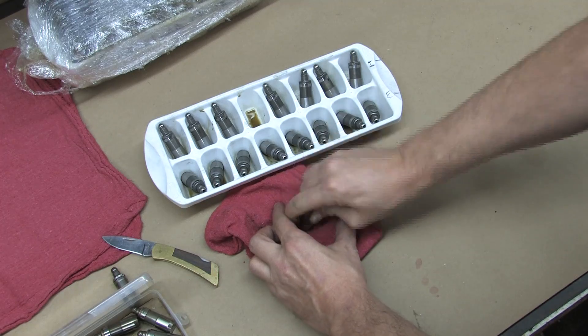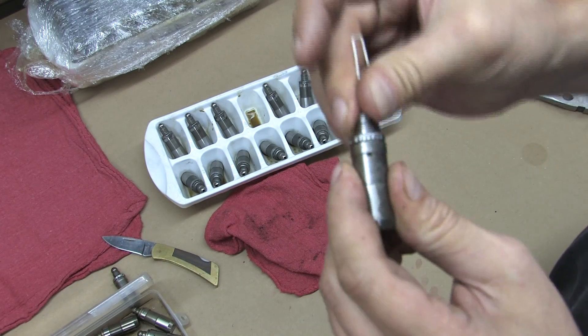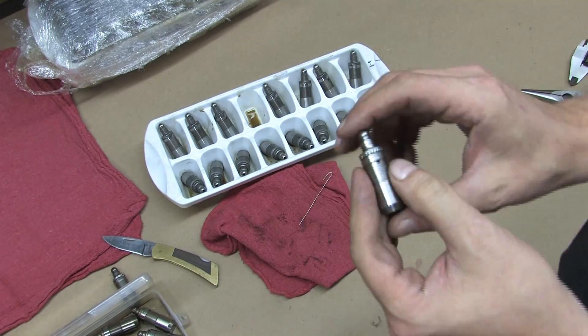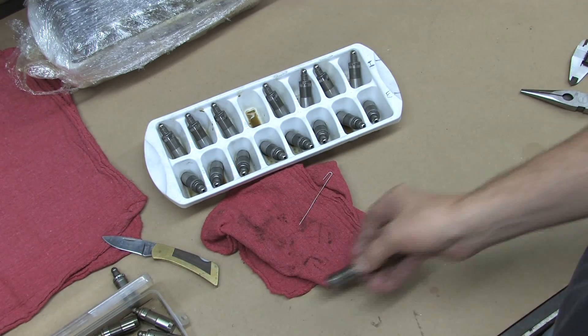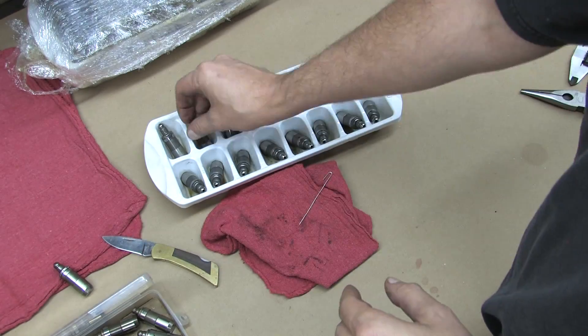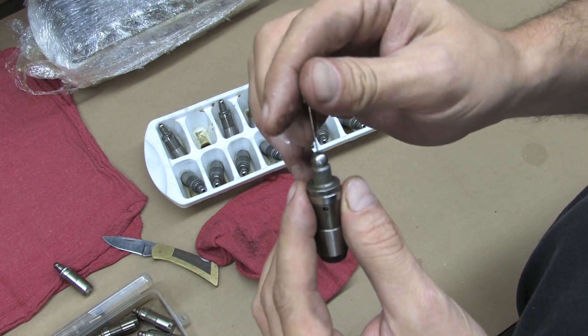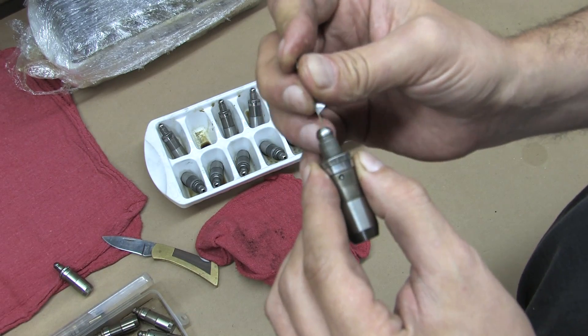I'm going to go ahead and clean my 3rd revision lifters out of my GSX because it ate metal shavings for the last mile of its life. I have no doubt there will be chunks, but because they're already the correct lifter for my engine, I can save myself 88 bucks just by cleaning them myself. I can do this because the rocker side has a big hole that will let all the junk out, and I can do it without taking them apart. It just takes a little time and patience.